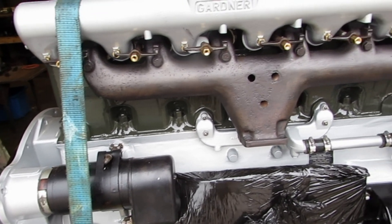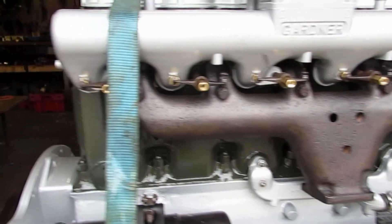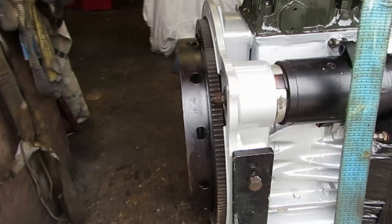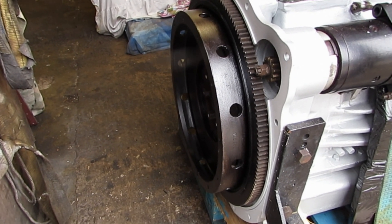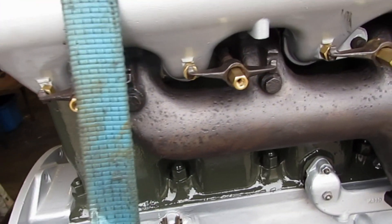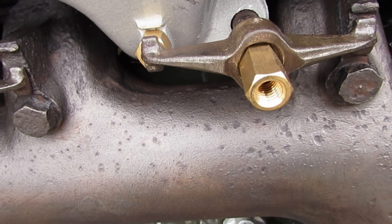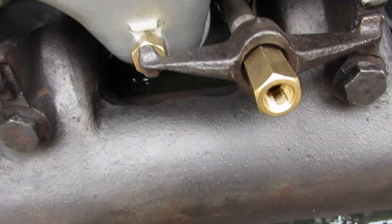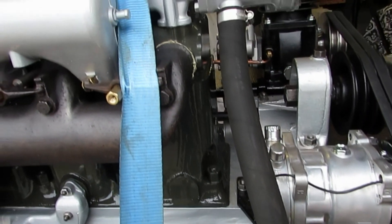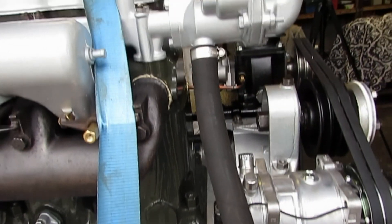On this side you've got the conventional centre-drop exhaust manifold as you would use on any truck. These mounts here should pick up the chassis and the truck okay. We've done nothing with the bell housing because the gearbox will be fitted by the user. You'll see these nice brass exhaust nuts here — they're a wee bit long, but that'll give them lots of grip; they're actually an inch long. We couldn't use the conventional copper bypass pipe because of the air conditioning pump, so as you can see we just use flexible, but this will be fine.